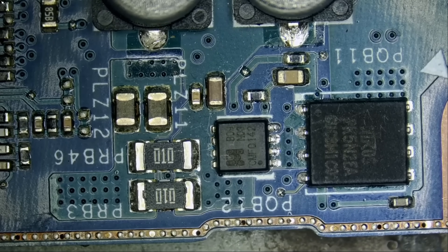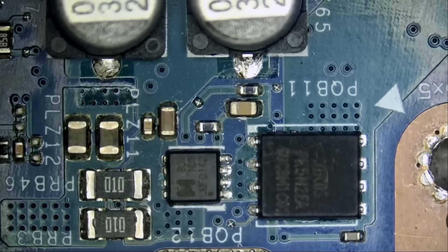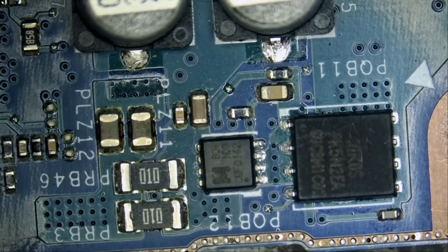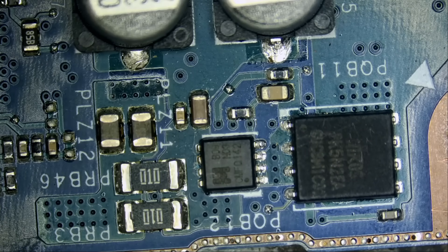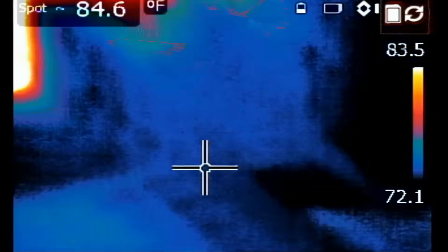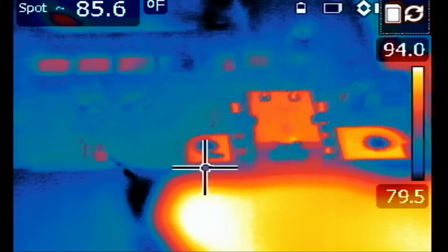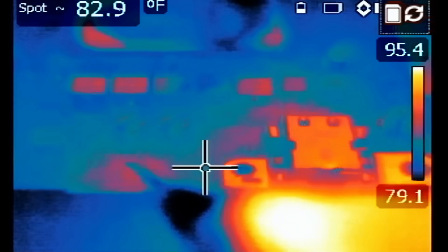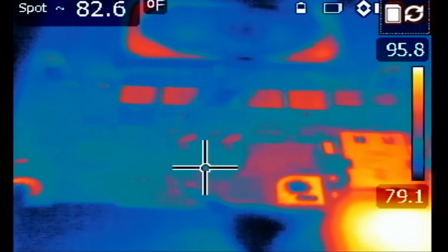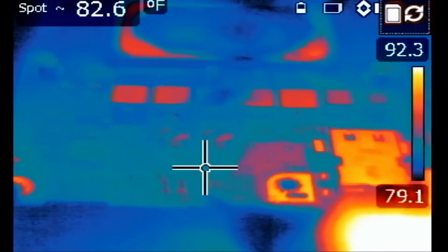What do we do when we have a short circuit on the drain of the DC power MOSFET? We're going to inject voltage and monitor the board under a thermal camera to see what gets hot. We do this on Asus, Lenovo, and every laptop on the market. Voltage injection tool on, currently set at 1.5 volts. We inject voltage here and monitor — and we see something hot right there. Heat is coming from the back of the board, so I asked Big Boss to remove the board so we can look on the back and see what's getting hot.